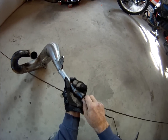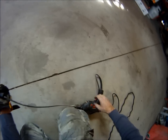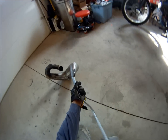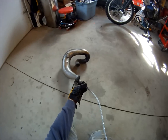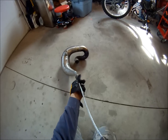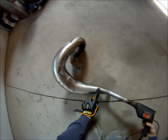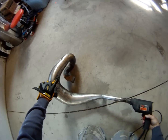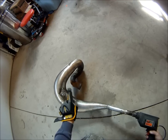I got a good little pile of carbon out even after Pacific Crest cleaned it. They may have just burned that one end and not worried too much about the rest. I didn't really get that much out. Just use a gloved hand — obviously I'm wearing safety goggles. I cut it long enough to where it would fit down about maybe two-thirds of the pipe, because it has to make this bend and come back and cover this area.